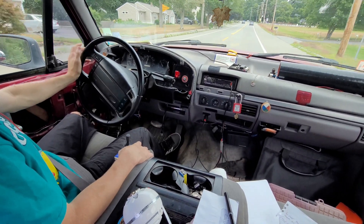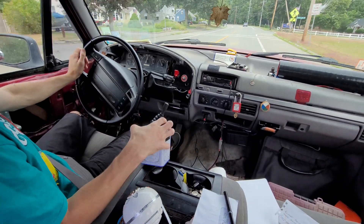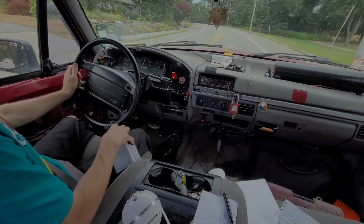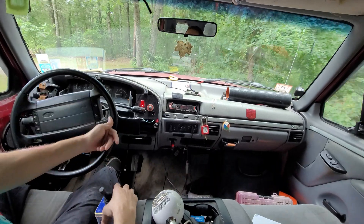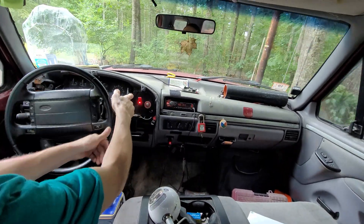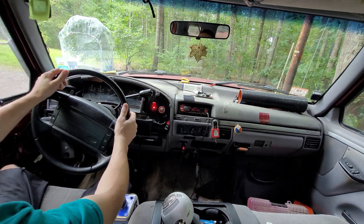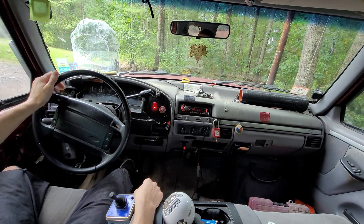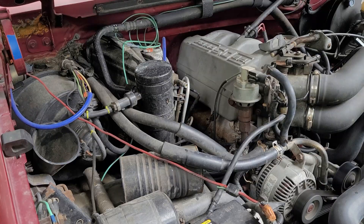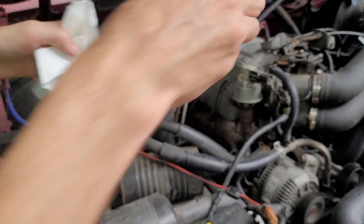While you're on a test drive, try to go through all the gears — first, second, third, fourth. Once you've gone through all the gears and had a nice little drive, you can come home and check the fluid level. Put it in reverse to let the passages fill up, then go to neutral or park — it doesn't matter, as long as you set the e-brake.